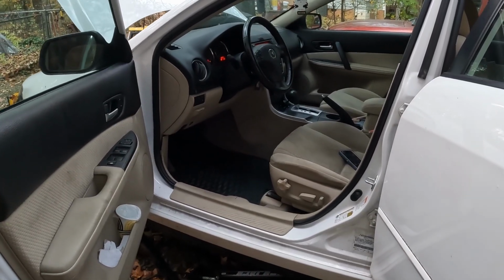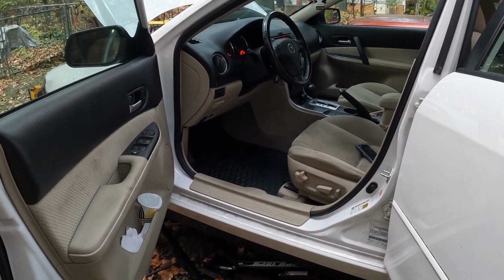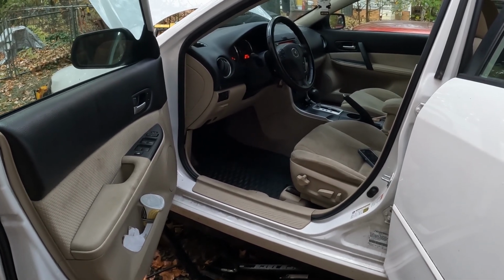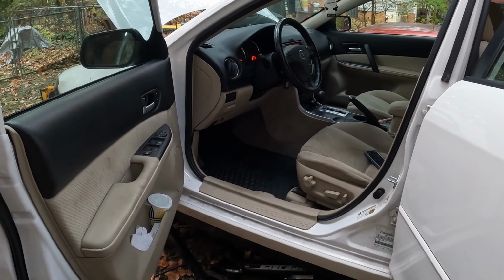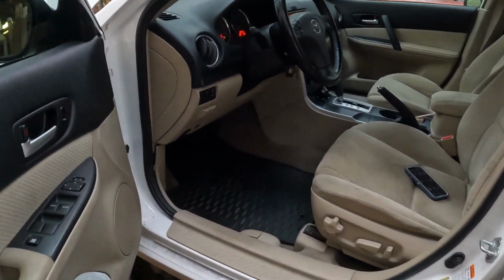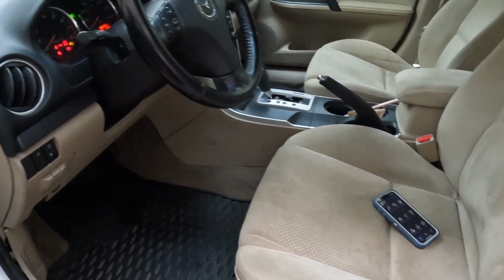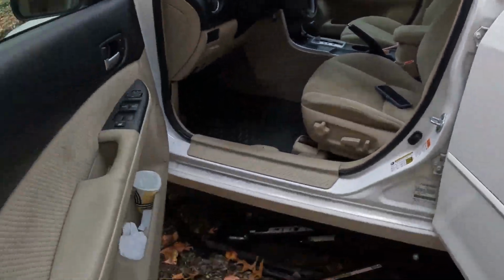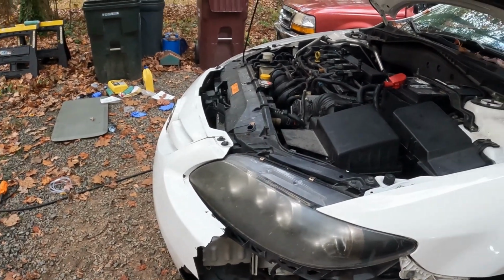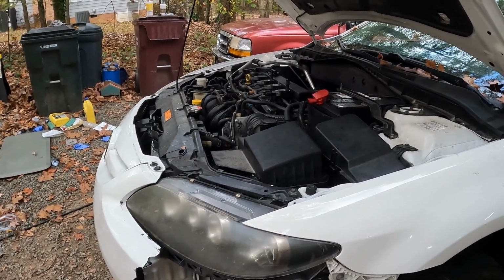So I am done. Now I probably have a check engine light because I messed with so many things, so I'm going to clear the codes, but I do have to clear that C1981 code. And I'm going to take her for the test drive. But I believe I have everything back together. Always double check, make sure your tools are on your tool bench and not in the engine compartment. So I'm going to clear that code, drive it a little bit, and test 2 things. The power steering pump that I did, and whether or not this code comes back.